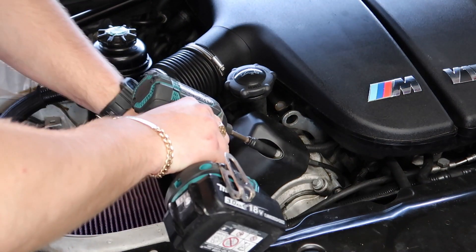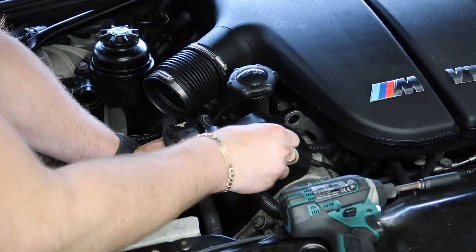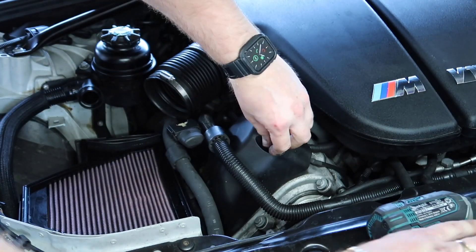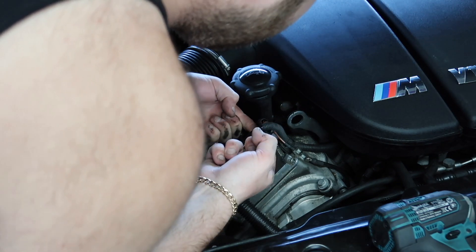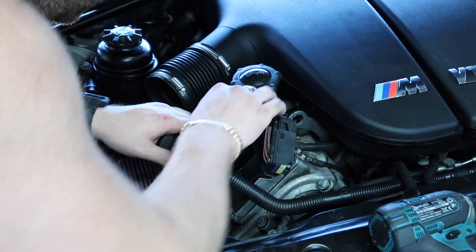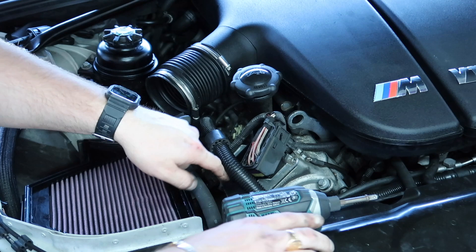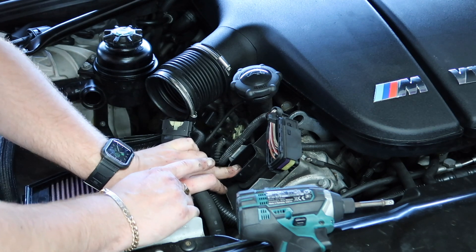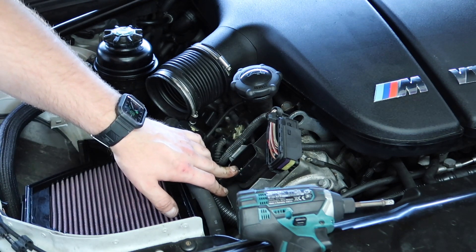I've realized that on the forums nobody really knows what's going on with people's cars on this issue. What we're doing here is trying to nail the problem down. We're going to switch these over — I can already see this one's been a common problem. You want to lift up the connector and move it out of the way. This one's already been had out before because all the Allen key bolts are missing. This is the control unit for the coils, spark plugs, VANOS — everything. These fail and a lot of people run around not knowing where to look because they're hidden away and everyone just checks the basics first.